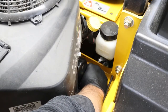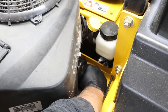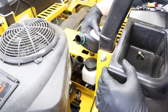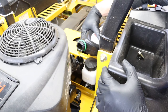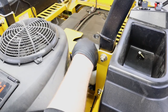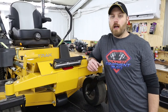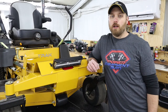Once all your oil is done draining, you can tighten down your drain plug and remove the oil drain tube if necessary. If you have a Kawasaki engine like this with the plastic drain plug, be careful not to over-tighten the drain plug. Most of these V-twin engines are going to hold two quarts of engine oil. Now you need to start and run your engine for five to ten seconds, then shut it off and double check your engine oil level. On these residential mowers, I recommend changing your engine oil every 50 hours or once a season, whichever comes first.